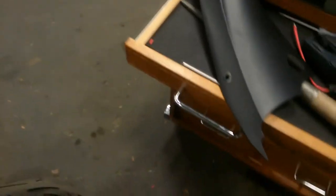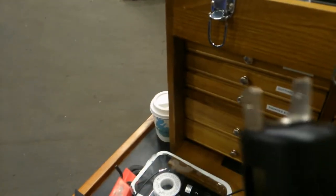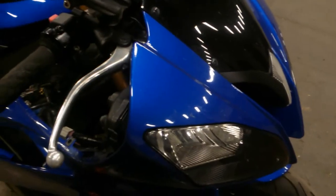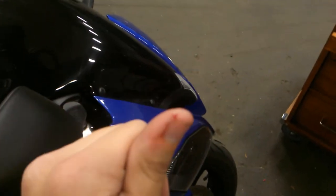Next is to shorten up the wires that came with this thing. Red one was in the middle, black one was on the side — you're welcome. So next we're going to solder the red wire and the black wire onto the two wires in there. We want it to be in parallel, that way when something's not connected to it our headlights still work. Also, that didn't work so I put super glue on it, like I probably should have to begin with.